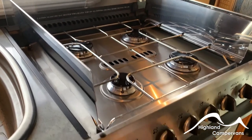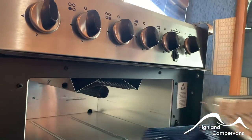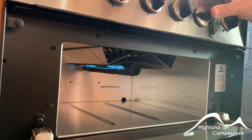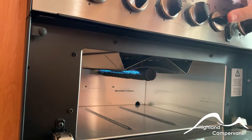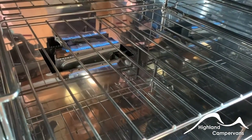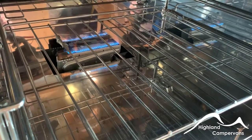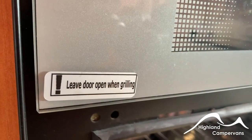If you want to use the oven or the grill, remove any plastic or protective packaging for transit first. For the grill, push in, hold for a couple of clicks and you should see the gas burner take on. For the oven, similarly, push in and hold for a couple of seconds and it should light up more or less spontaneously. Turn everything off when you're travelling.